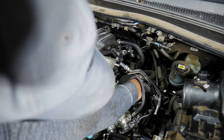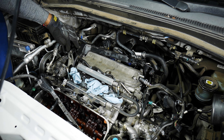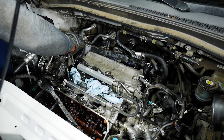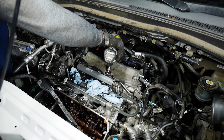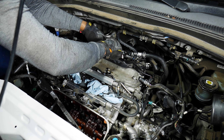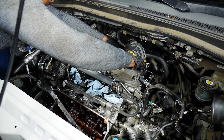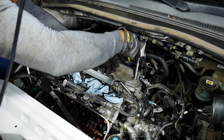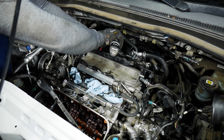The clip is one of those where you push the tab and then lift it off the bracket. I'll try to get it a little higher first — there we go, it's off. According to the service manual, I just need to take out this ground wire bolt. I'm going to put the bolt back in the hole. This one here is right below the water hose — I'll use a swivel adapter with the 10 millimeter socket.